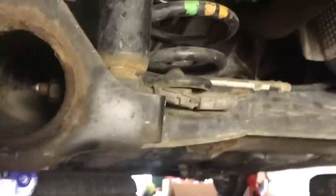Now that the front is removed, I'll show you how to remove the rear — this one's very simple. If you're not taking the shock all the way off, you have two 13 millimeter head bolts up top, and then one bolt right here that goes through. You want to get an adjustable wrench on there — there's a nut on the back — and that comes right out. I'll show you how easy it is to get the spring out.